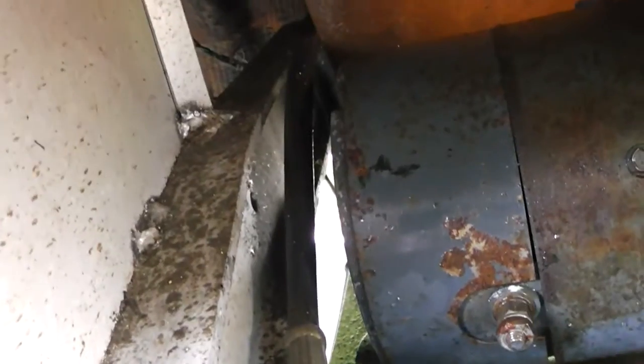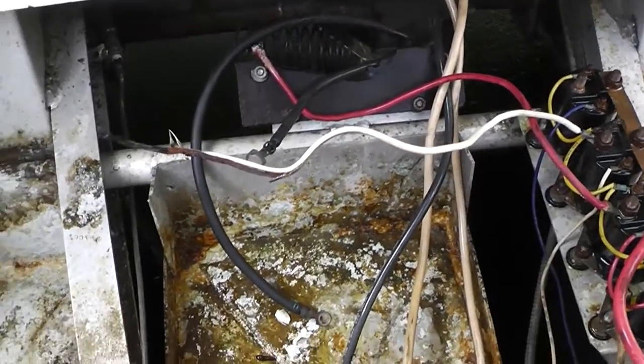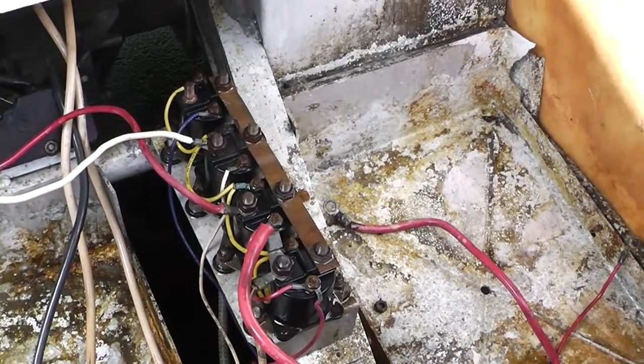What is it? Look at that, that is huge. That is a brake line. That's hydraulic brake lines. And you can't see it from the motor, but it does go back to the tires and it's hydraulic. And I gotta figure out what's wrong with it because it ain't working. So I need to drain it and fill up with good fluid and re-bleed it if there is a way.